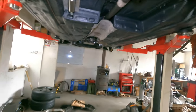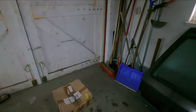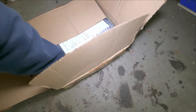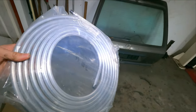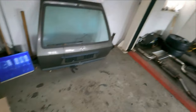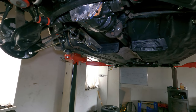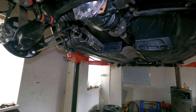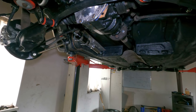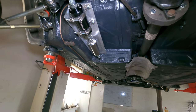Now I have to sort out the best routing for the aluminium line I have over here. This is an aluminium fuel line, half inch - the same size as AN8. I am lowering the car first to have a look where I want to put the line going into the car, and also I need to have the E85 sensor adapter in there. I am going to lift the car and have a look under the hood.